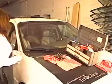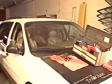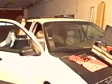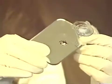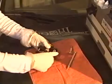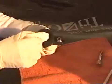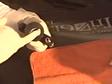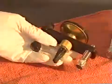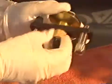The second step of windshield repair is to inject the resin to completely fill the break. First, place the mirror inside the windshield, allowing you to watch the repair fill with resin from below. Screw the injector base into the Tri-Glass bridge. Apply suction cup lubricant to the suction cup. Check that the suction cup is screwed on tight.